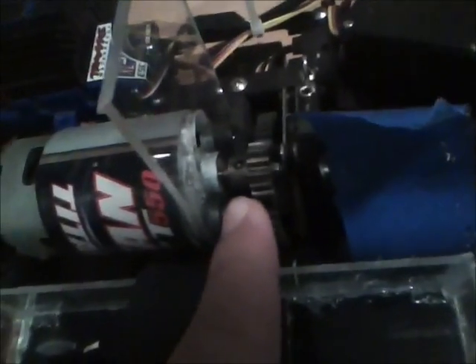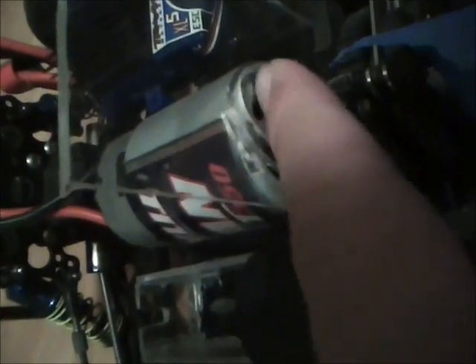Over here I drilled the motor mount holes for the screws and the opening for the motor. I have a rubber washer there because the screw can't go in too far into the motor, otherwise it'll hit the motor's internals — I found that out by trying it. And this is a Mod 1, 14-tooth Robinson Racing hardened steel pinion gear.